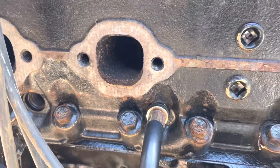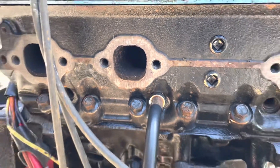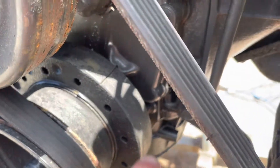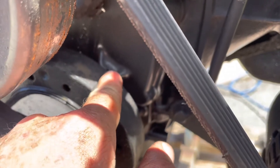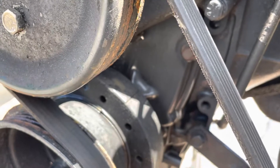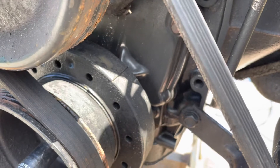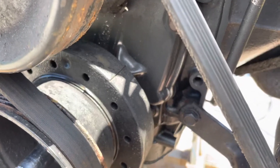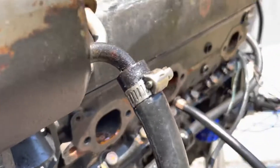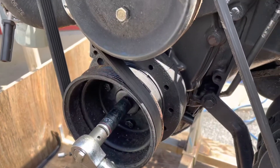This is cylinder number four — 80 psi with a slight exhaust valve leak. I've got the top TDC mark right in line. The firing order on a 4.3 is 1-6-5-4-3-2, so four is opposite one. The next in the firing order is three, so I need to move 120 degrees and do cylinder number three, which is the middle cylinder on the port side.